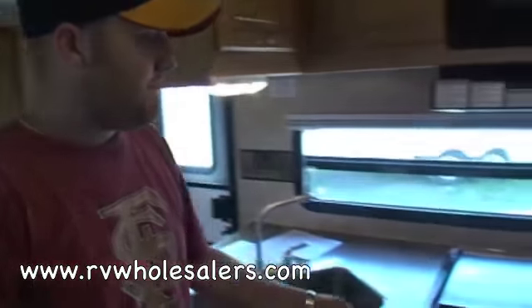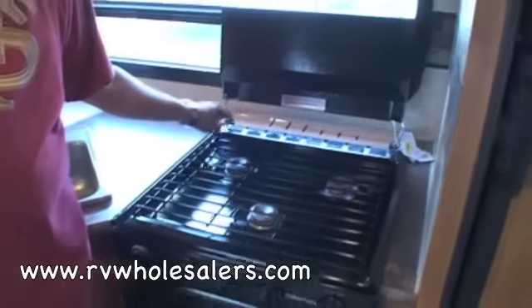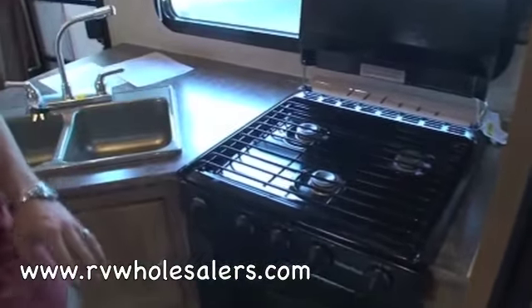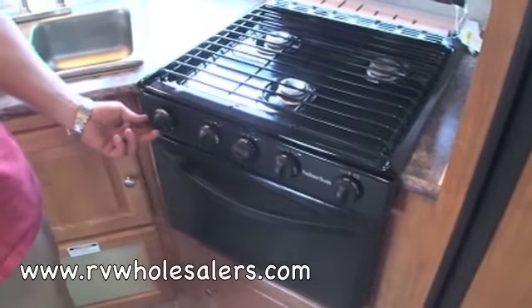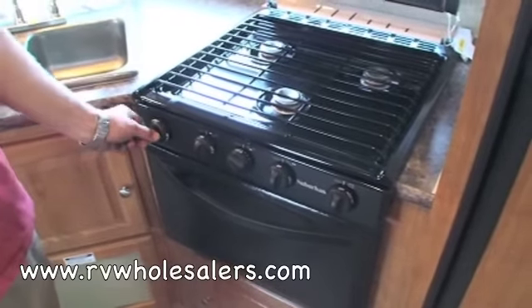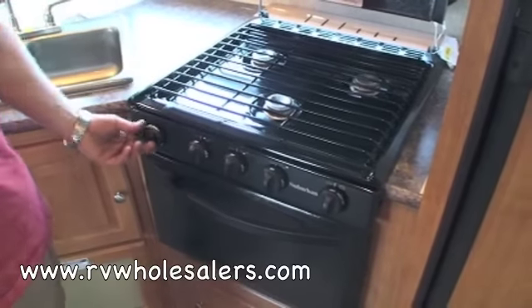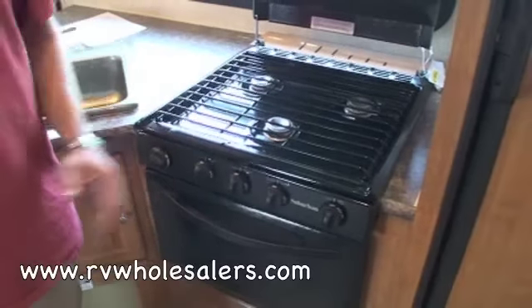Your cooktop — the way this works, you're going to lift this up about four and a half inches. There are little teeth that lock in behind this to hold the cooktop in the position that you need. You're going to turn your burners on to light high, and you're going to twist the top burner spark over. Every time it clicks like that it's sparking the burners. You need to keep clicking this as many times as necessary in order to light your cooktop.